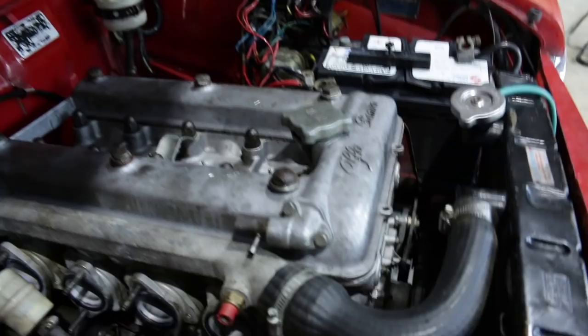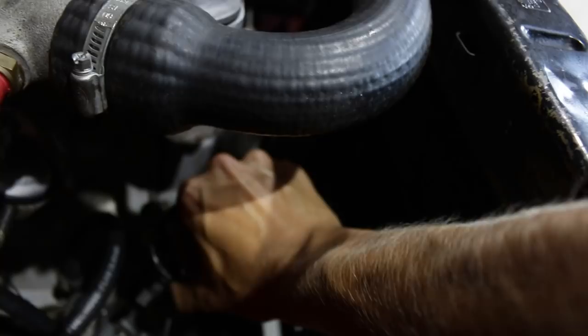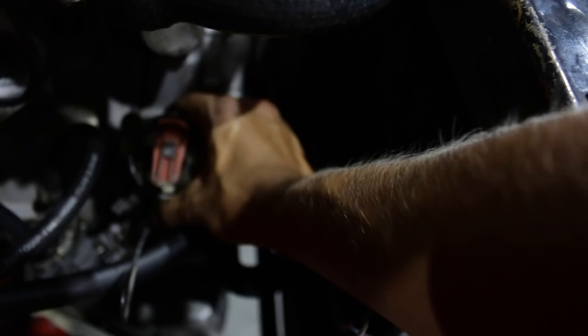All you have to do is make sure that you have a correct coil, and then get the engine to TDC, which is where I've got it, on the static firing mark at the moment. And I'm going to pull that distributor out. Let's see. Notice where it's pointing. Cylinder number one's firing. Now it's loose. Right. That wasn't too tricky.